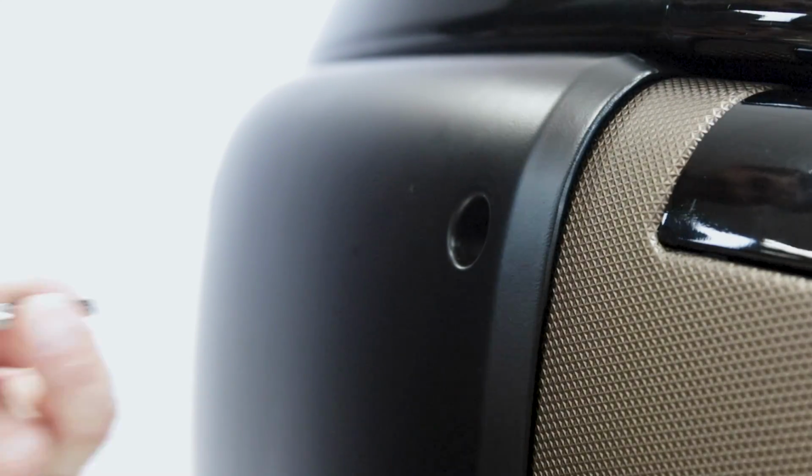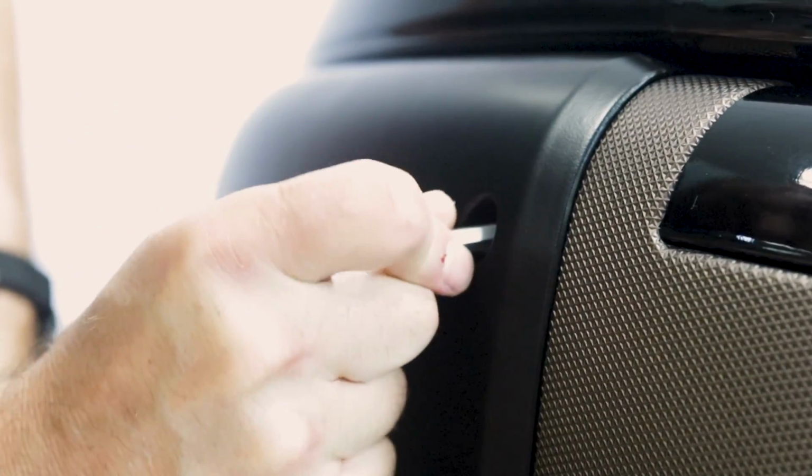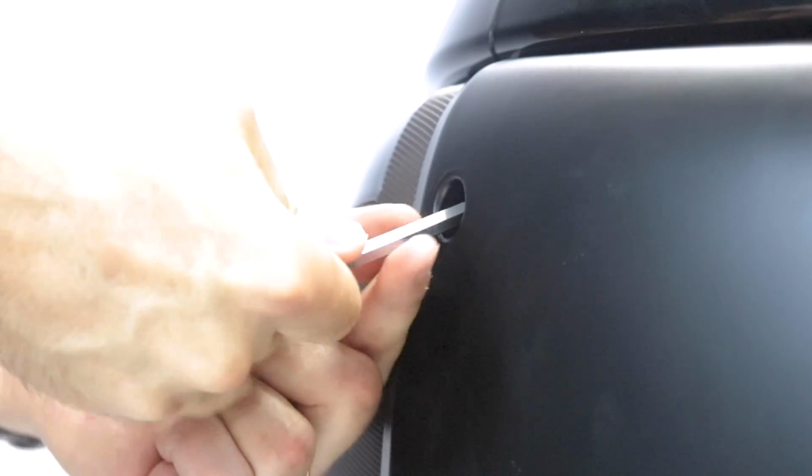Position the plastic cover so that the ball and socket fasteners are aligned, then press into place until you feel it snap securely together. Using the M5 screws, secure the back cover into place through the 4 screw holes located on the back cover.